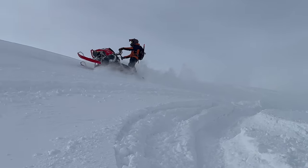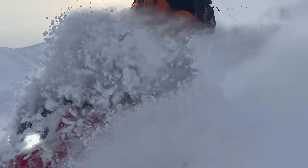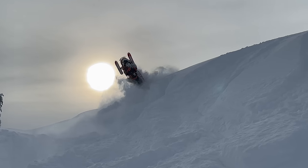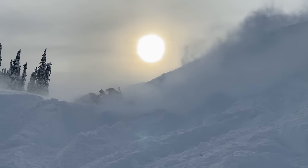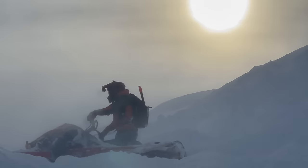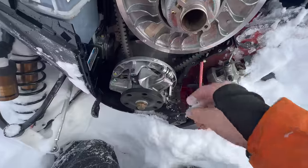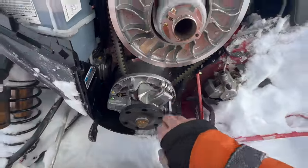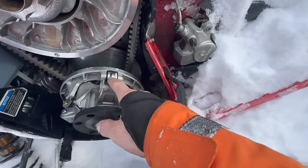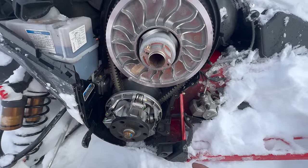Now there's rock there. Clutches are warm, that's for sure. We're over revving a bit though, so we're gonna drop our clickers down from 3 to 2. We're getting lots of backfiring. Don't need to blow some reeds.